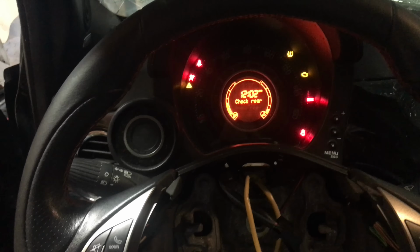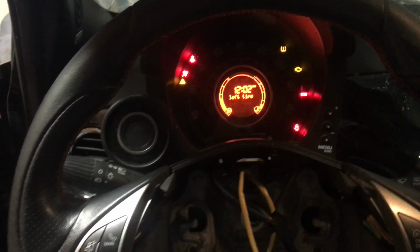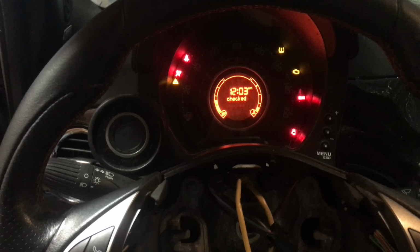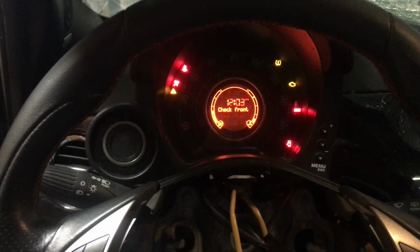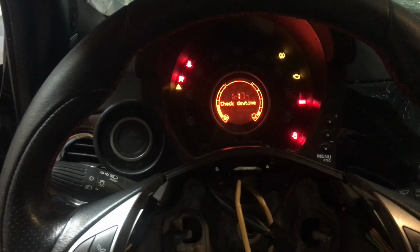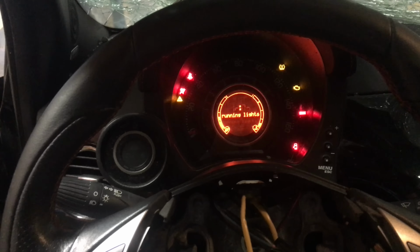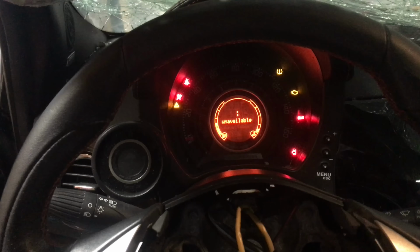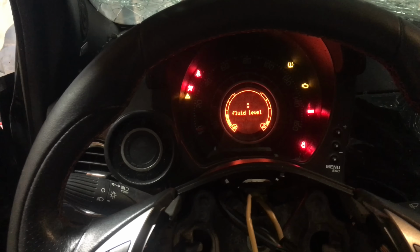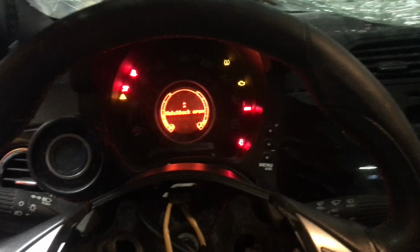Starting to sound a little bit more normal. Multi-air engines are pretty loud just because of how they operate, but the intake camshaft is, actually there isn't one, there's just an exhaust camshaft and some electronics and some bucket lifters. I'm guessing those bucket lifters are just a bit empty. Nice and responsive though.